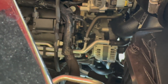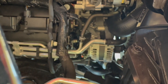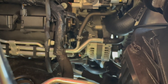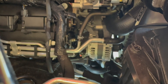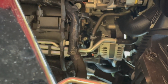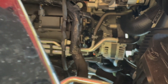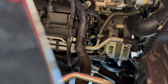I have the dual alternator package on this particular truck, and this alternator here on the lower part — there's one above it on the other side — and the lowest point on this alternator is around 36 inches. Certainly wouldn't want to get that wet. There's also a connector there that's a little higher up, maybe two inches higher, right in this area down there centered on the camera right at the alternator.